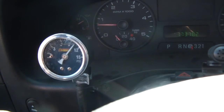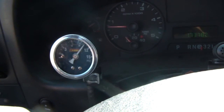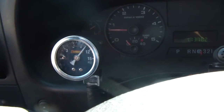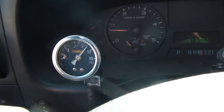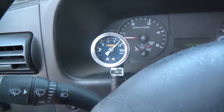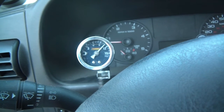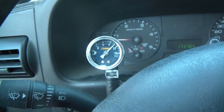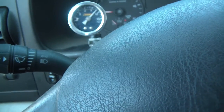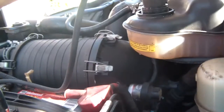When I brake hard it seems like the pressure drops noticeably — I don't know if that's normal. It hasn't gone over 12 psi yet; 11 was probably the highest. I haven't been able to get on the freeway and really romp on it for a long time. I live in Newport Beach and the summer beach traffic is a nightmare. I'll do another bubble test when I get back. The pressure stayed just under 12 psi and the bubble test isn't showing much bubbling.